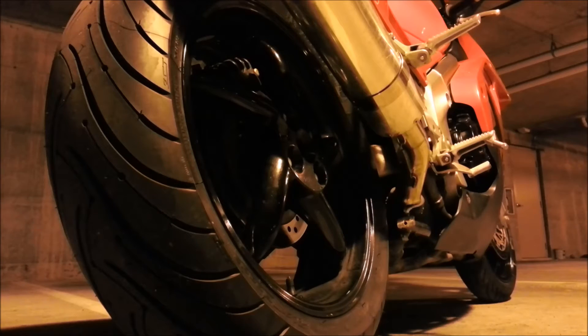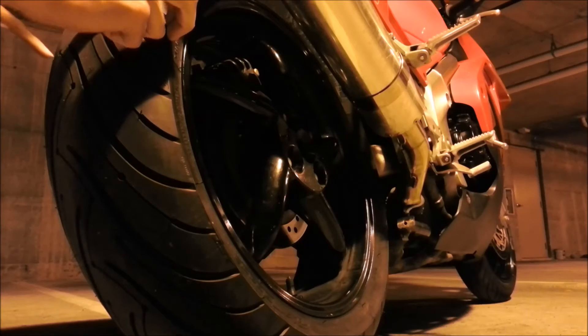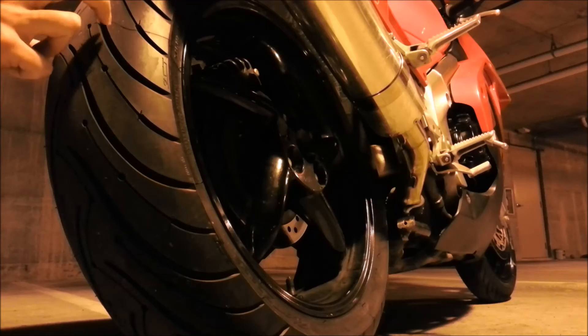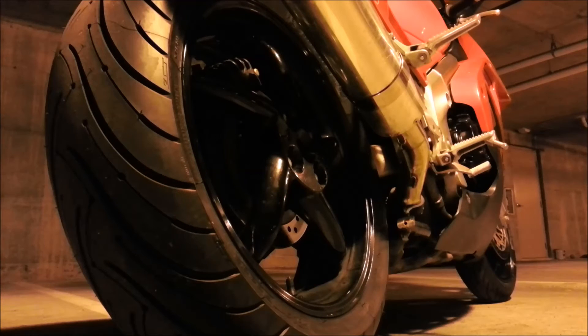But I'm more of a sport rider, so this sort of thing for me was kind of a scary choice, because even though this is a fantastic tire, I wanted to do the Pilot Power 3 on the rear, because it is stickier — even though it will burn out faster, it will still keep me confident in the turns. But I did learn that this tire, the Road 3, has the 2CT compound on 25% of each side. So you do get that 2CT super sticky compound on the side, and then you get a firmer compound — even more firm than the front Michelin Pilot Power 3.